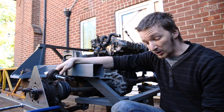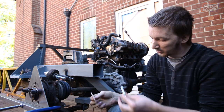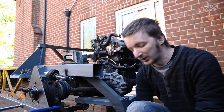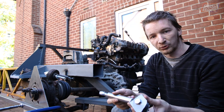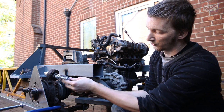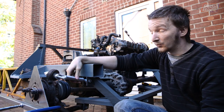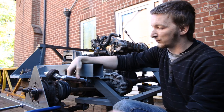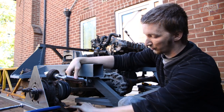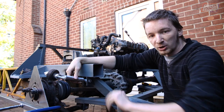Similar process to the front arms: we made a cardboard template to fit under the chassis and onto the drop leg, made up metal plates, drilled those to make the actual hook-ups, then popped it onto the through bolt. That's our completed rear upper radius arm. We've now effectively got a full wishbone arrangement up on top, with a single arm underneath, and we can weld this up, start adjusting, and get our geometry right.